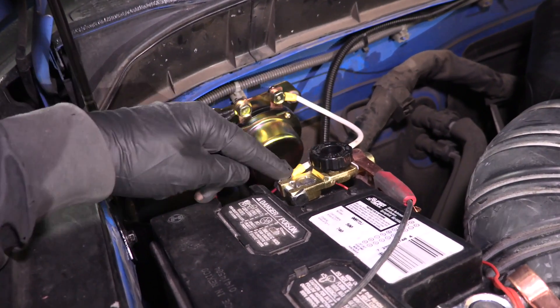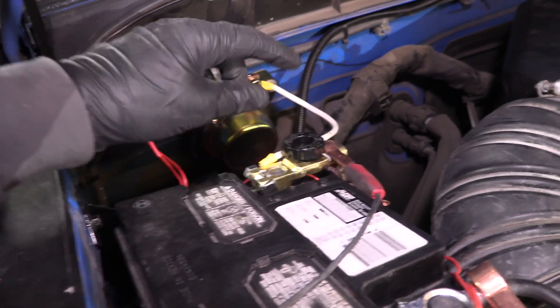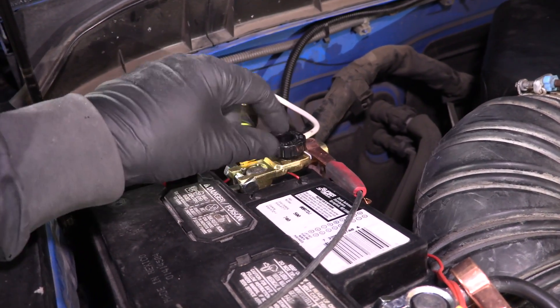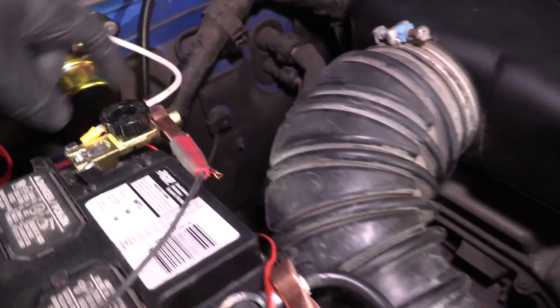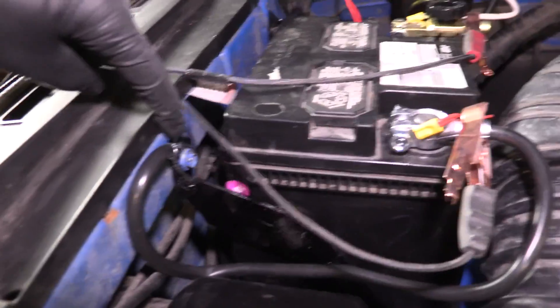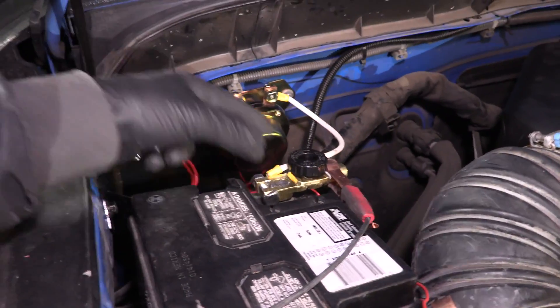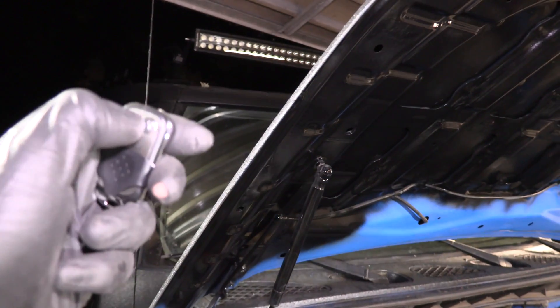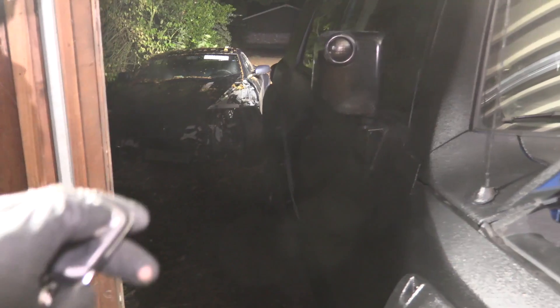The other side of this needs to run to the battery's top post here — this side is always connected to the battery. This is a disconnect that I'll show you in a second, and then we have the ground and our little boxes wired in back there, kind of hidden. The ground runs back to chassis ground near our relay. So that's the battery ground and battery positive sorted. As I click this remote: that's off, that's on, that's back off again. The back light bar is working as well — you can see it's all lit up back there.